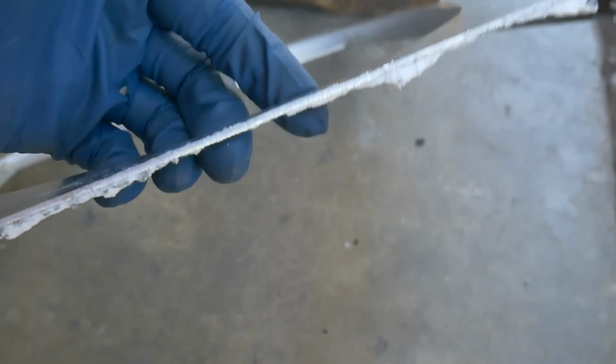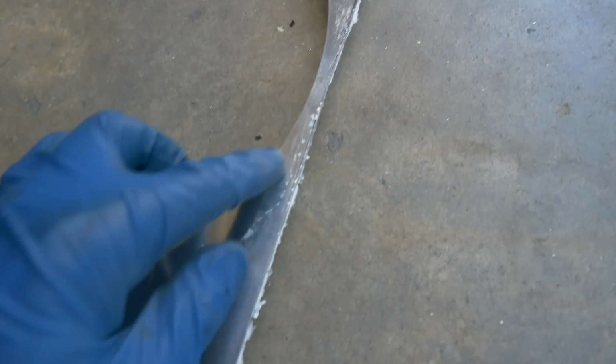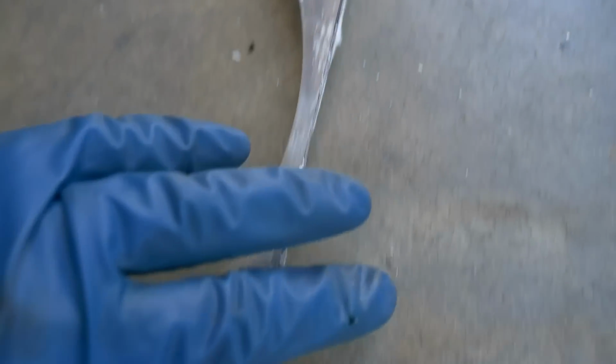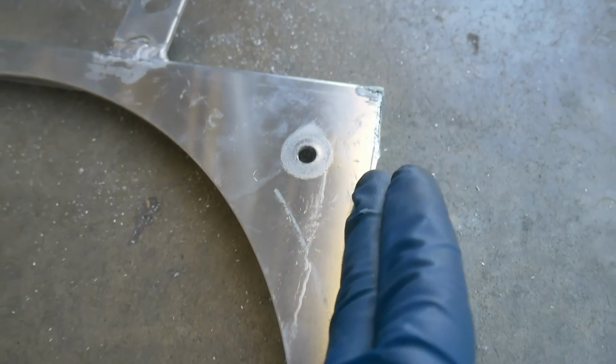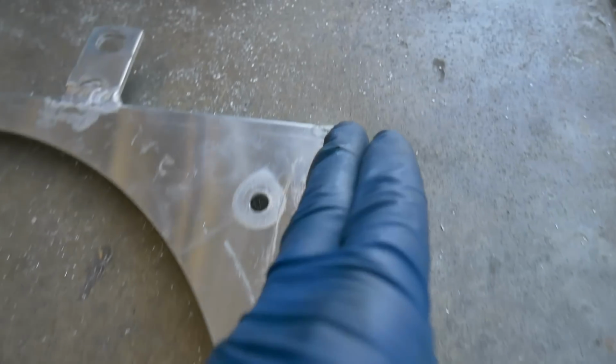And after the initial cut, it actually came out pretty straight. And it was bent a little bit here, so it's so easy and flexible that I bent it back. That's why I feel like the end plate will strengthen up this edge if I can get them to weld together. I'm gonna go ahead and use my grinder now, and I'm gonna clean off all these edges. I'm actually gonna do it at an angle so it has a little bit of a ridge here. It's kind of like a beveled edge where it angles down this way. And I'm just gonna do that to clean off all of the aluminum. And then also, I wanna weld it there. When I have the piece on it, I wanna be able to have that little channel there so I can run the brazing rod right down that area and have both pieces weld together.